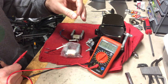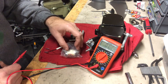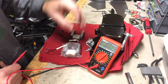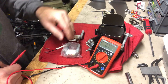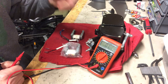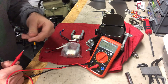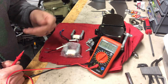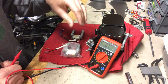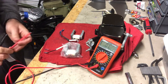For a few extra dollars at bicyclemotorworks.com, Zeta, Amazon, or numerous other places, the OZ magneto delivers 10 percent more energy to your CDI. Couple that with an NGK spark plug boot, an NGK B6 or B7 HS spark plug, and a 7 or 8 millimeter copper core wire — and you're really moving. Definitely recommend the Super OZ magneto for a few extra bucks.